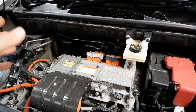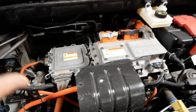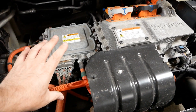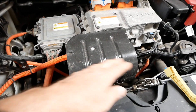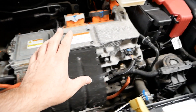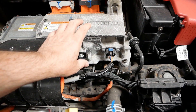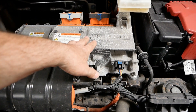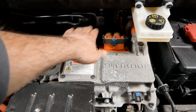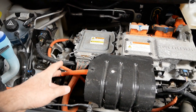There's a sticker on the side here showing the brand Yazaki, so yeah, clearly Japanese. It's very reliable in these, as it is in the iMiEV — a very reliable drivetrain. This is your motor stack; at the bottom there will be the electric motor driving the front wheels directly, and then everything else mounted in these aluminium carcasses is all your electronics, your charging systems, and your inverter.